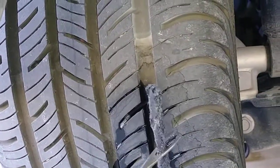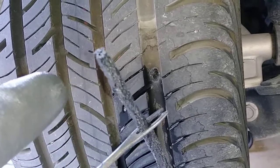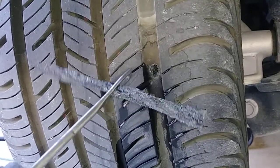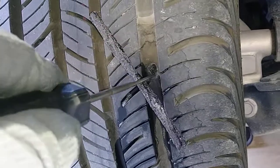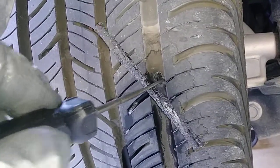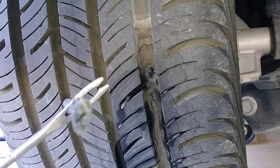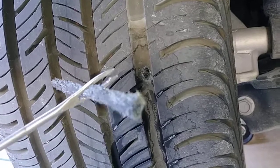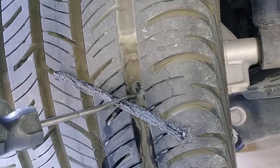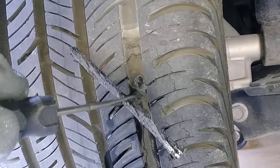The hole is a little bit wider now. That's why you have to widen the hole, so the plug can go in. This is a very sticky material, so it will go in like this and it will double up. Then when you pull out — you see the fork — it will come out of that because it will stick around the tire material, the rubber.